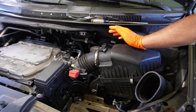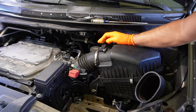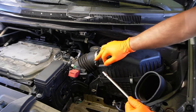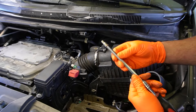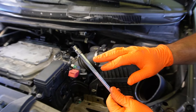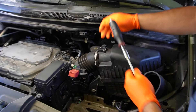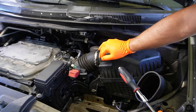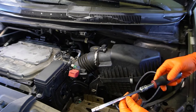The next thing you're going to want to remove is this intake. Go ahead and disconnect the pigtail that goes to the mass air. When you get to these clamps and you're trying to find the correct socket, it's actually a 5.5 millimeter. It does have a spot where you could put your Phillips screwdriver in and twist it off, but if it's too tight to break loose, you're going to need a 5.5 millimeter.